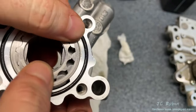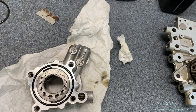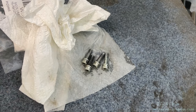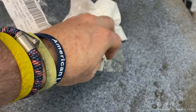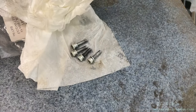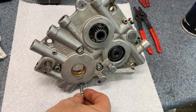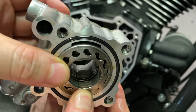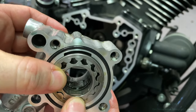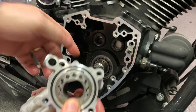Important note: the keyways in this pump are independent of each other and we'll need to line them up later. I'm getting four bolts ready — all the bolts in this section had blue loctite on them, so I'm cleaning them up on the wheel and hitting them with carb cleaner, then preloading them into the four numbered oil pump holes. To make things easier, I want to align this pump onto the engine first. These flats need to be aligned to each other — I want to align the back one first and then the front flat.